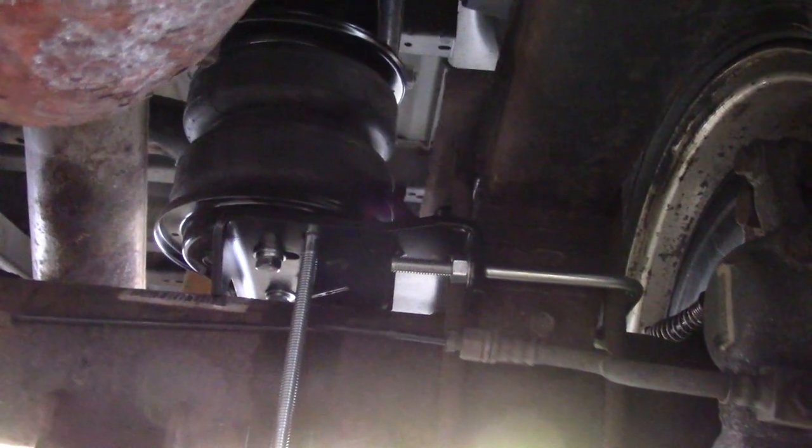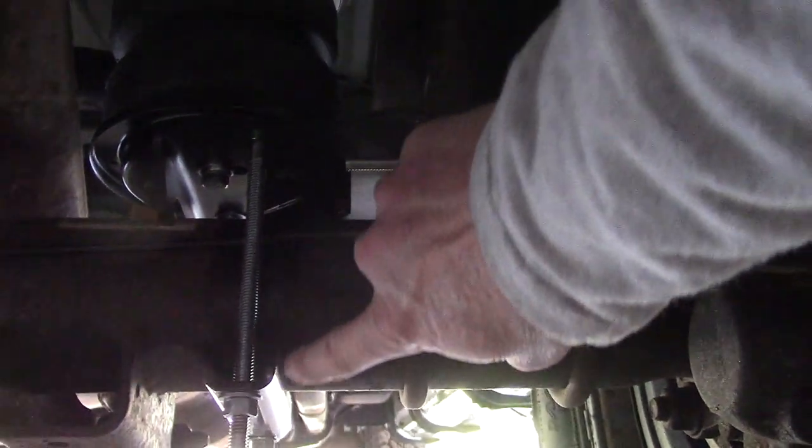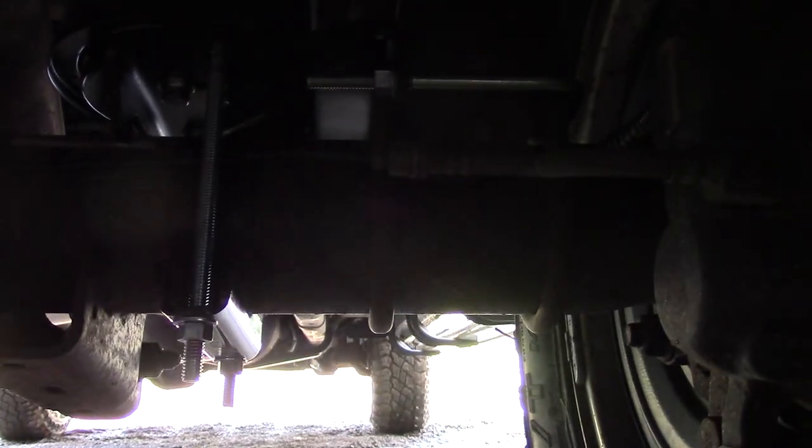And again, one thing you'll notice, those bolts would normally be Nylocs. And again, the ones I was short on were the ones for these, and the plate bolts that are, I'm going to give you a shot there, that bolt there. But you can see the red Loctite, those aren't coming off. If I get worried about it, I'll either chase a Nyloc on there or I'll just swap out the bolts one at a time, or nuts one at a time. Won't be a big deal, but I don't think it's going to be a problem.